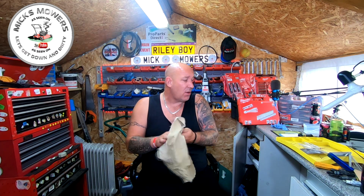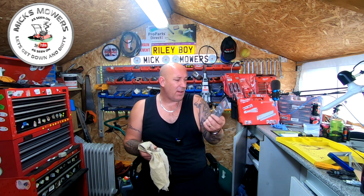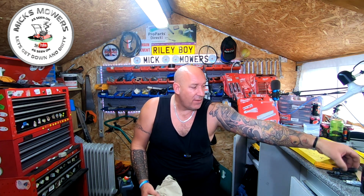Okay, so there you have it, quick and easy video. How quick was that? All right, you've got to take the head off, maybe a new gasket, but that is the drama. But in reality, for a new head gasket and just removing the head bolts, it's no big chore, you know, it's six or seven bolts, it's no biggie. And then just pick yourself up one of these thread chaser kits. There's a part number, it is made in China. You can get them on Amazon or on eBay or any other tool specialist, and just make sure they get the right threads for you.